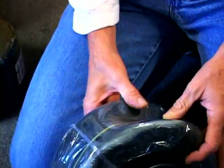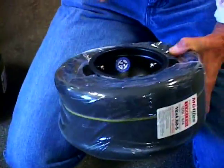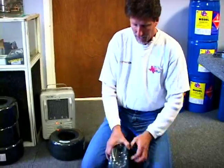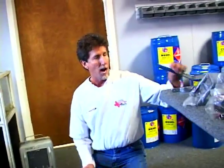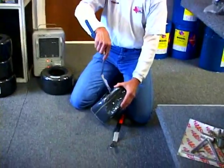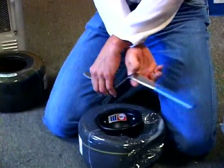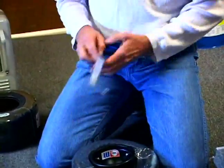Taking the tire off, you have to have a machine to break the bead. Generally you take the tire off the same way it came on, and then pull the rim out from underneath it. Sometimes you can use some tire tools — these are made to take stuff off. Basically goes in and there's a cap that goes around it and you rotate it to get it off.